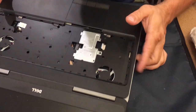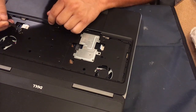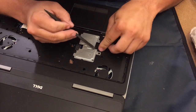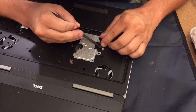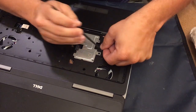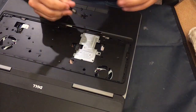We're going to make sure everything's tight, then get those cables back in — being very careful that the verticals are seated down properly and the wires are all the way inside the little slot. It's sometimes a little bit harder to tell with these because they don't have the notches like the ones that lay down flat. Once you get it in there you have to make sure that you push the keeper down on both sides so that it actually seats down and isn't cockeyed, because if it's cockeyed it won't make proper connection.